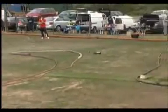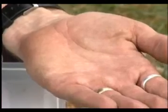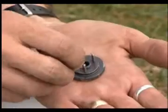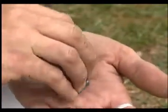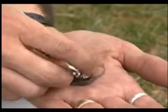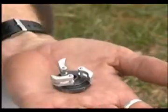All nitro engines use a clutch to drive the bell, which drives your spur gear, which puts power into your transmission. There are various types of clutches, and the setup of them is crucial to how much drive you get. Your typical nitro clutch is a flywheel holding 3 clutch shoes on 3 pins, and the centrifugal force tries to throw them out when they grab the clutch bell.